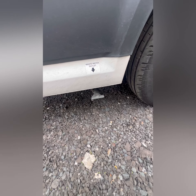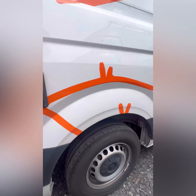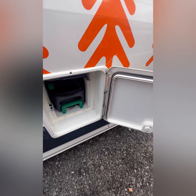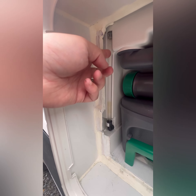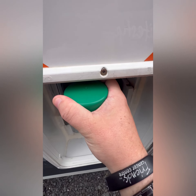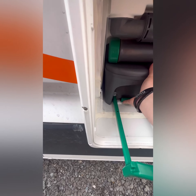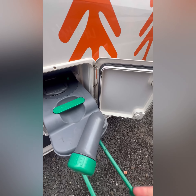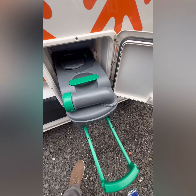Waste water just needs to be emptied when you're returning the van — just twist this and that'll empty the waste water tank. Your toilet cassette also needs to be emptied before you return. This here is for your flush — you can see it's empty at the moment. To fill the flush, take the nozzle off, screw it off, fill it up with liquid or water. To empty the cassette, click it up from here, pull it out, then twist and unscrew — put it in the drain wherever you are. Just make sure it's cleaned out and returned before you bring the van back to us.